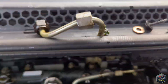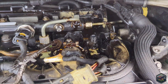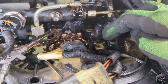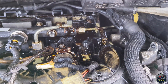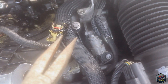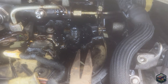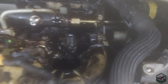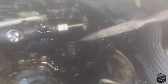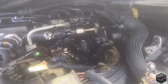That was the easiest bit — it's a 17mm spanner, you just undo that and pop it off. Now I've got that out of the way, I'm going to disconnect the connector here and try to start pulling this injector out to get to the seal. I got the connector off using some long nose pliers — pushed it together and at the same time pulled it and it just came out. It's a bit gooey, and now you can see how bad and dirty it is. There's a bolt at the back here that I need to get to.